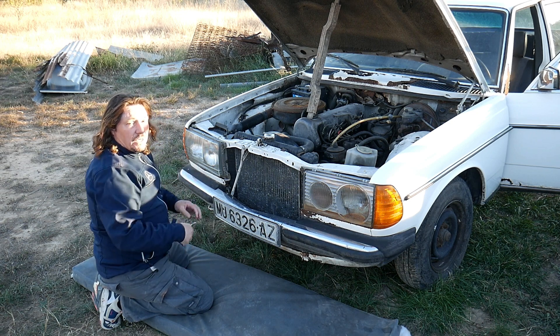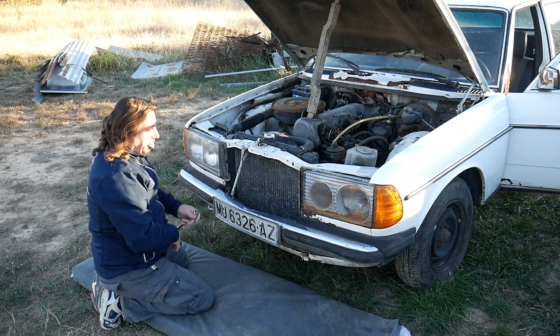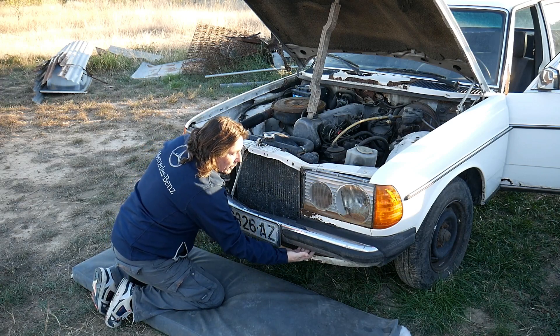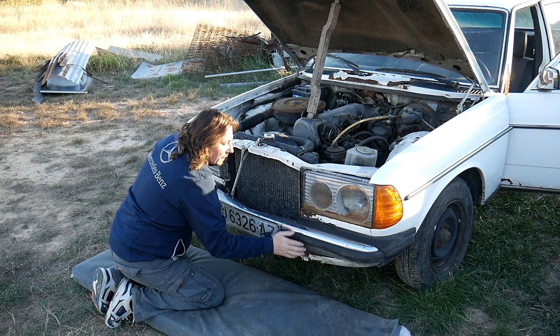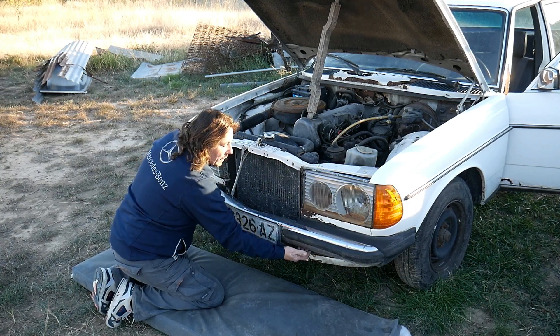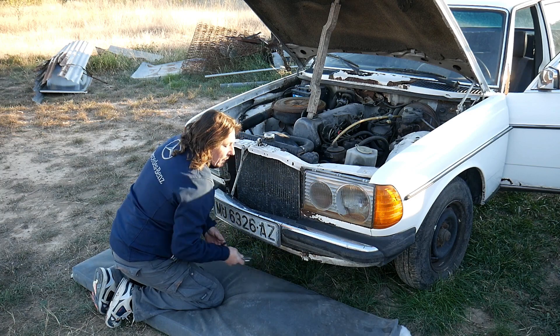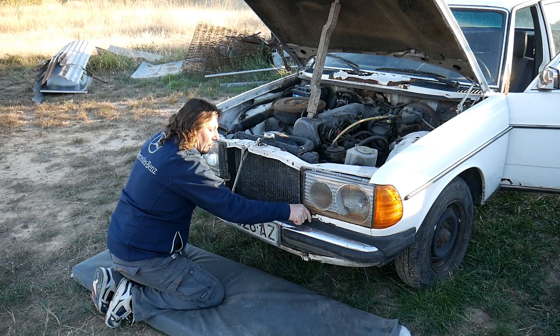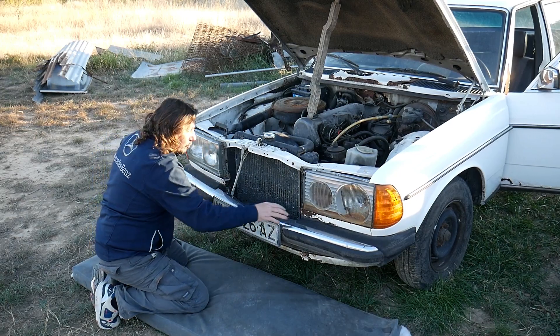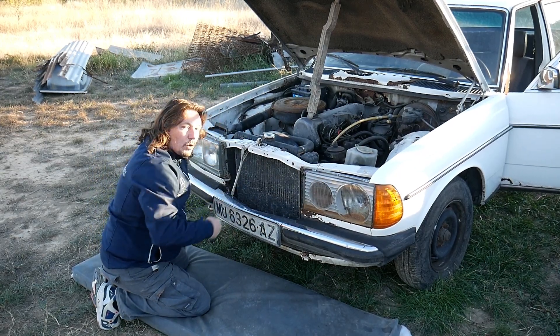How to remove this? Very easy. You use a 17mm spanner, and if you look under the bumper you will notice that there's a bracket — one that's fitted on the car and one on the bumper. So you remove the bolt that's on the car, and the same thing on the other side, then we'll continue.